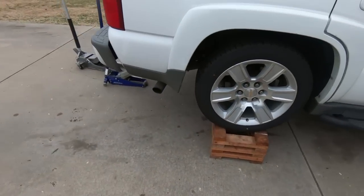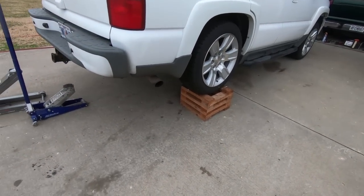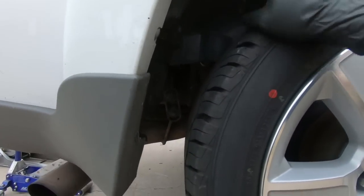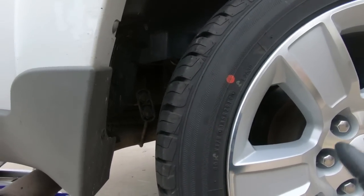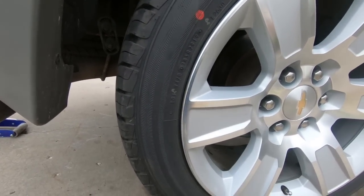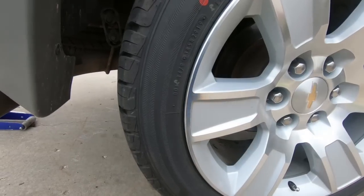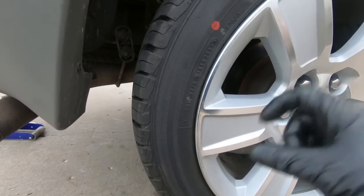Well, we have everything tightened down on the back underneath, and the only thing, guys, that I think I might run into is obviously that I'm waiting on those shocks. These shocks are just bottomed out. There's no way this is going to ride good. The other thing is I think my bump stop's a little tall. So in the description I will list a shorter bump stop. Chances are it's just going to ride on the bump stop, and that would make for a pretty rough ride. So I'm going to go with the shorter bump stop that I'll list in the description.